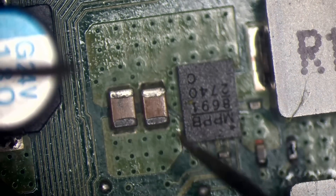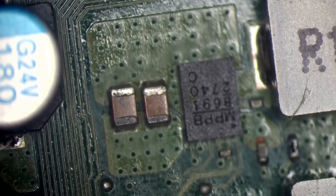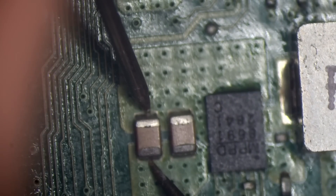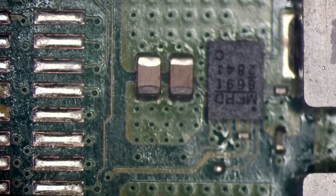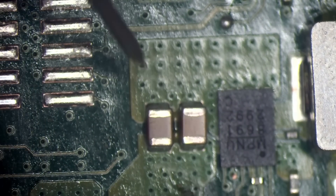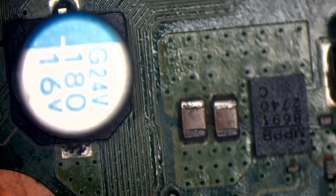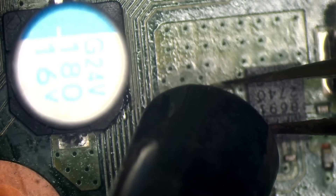So that's where the short was. It looks like we've got liquid damage here, and there is definitely a short. These are all probably going to show up as short because they're all connected together. These ones actually look rather good, although they are still showing up as short because they're all connected together. I'm going to remove these top two capacitors. I've got my hot air at 480, and I'll try and focus this heat on the caps instead of on this aluminium cap at the side of it.